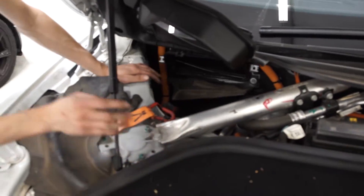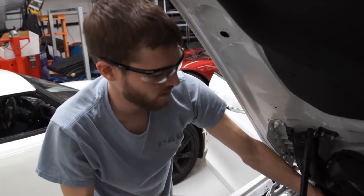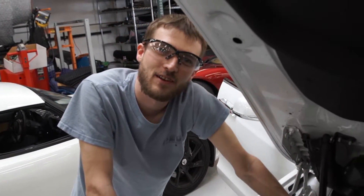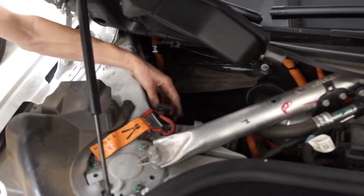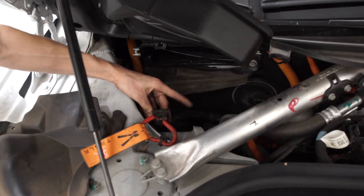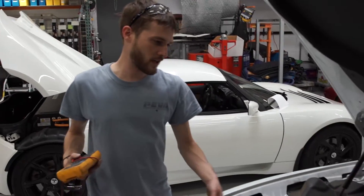Now normally we would have the power turned off inside the car, but this screen isn't working. If you've got a 2015, there's no battery right here, but you do still need access to this 12 volt or this high voltage disconnect, so we do need to unplug this. Now we've got to get the front out to get access to the 12 volt battery.